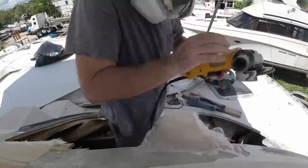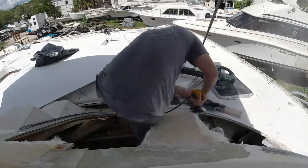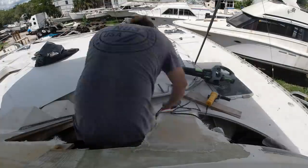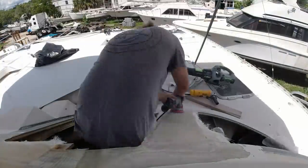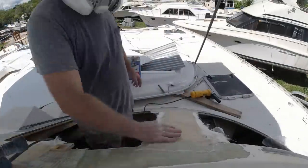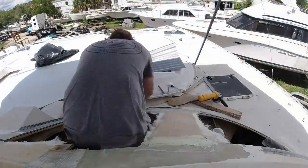Because this glass is so thick with the triaxle, it's hard to really get the edges to feather. What I do is, after I lay the glass, I'll come back down between sequential layers and feather the end. You want to be careful not to sand through important layers — like you want to not sand through the unidirectional in this triaxle glass. You want to make sure you're just sanding the mat off.